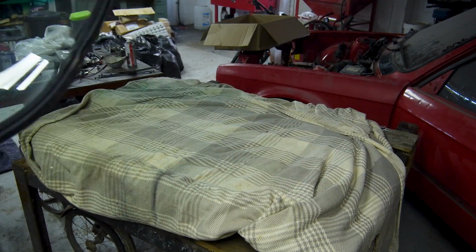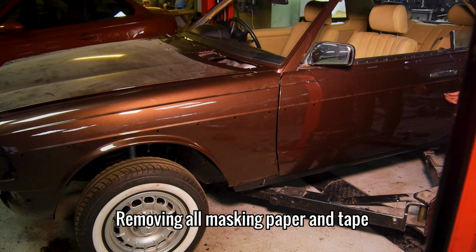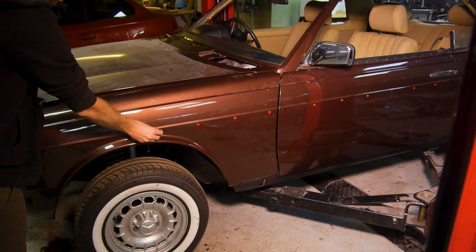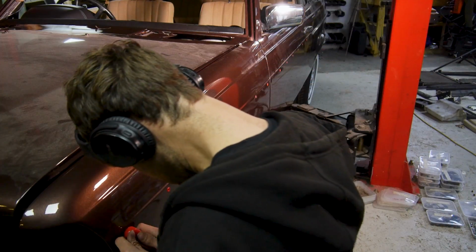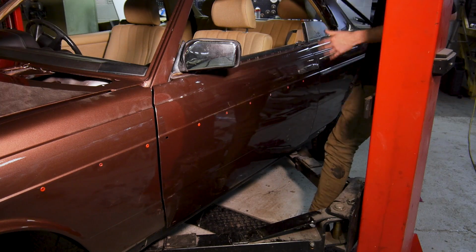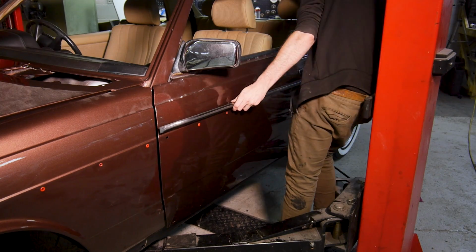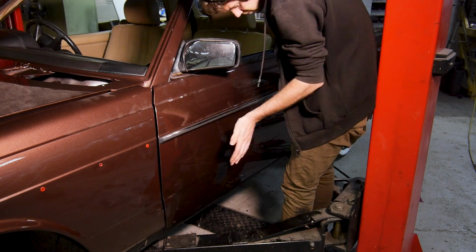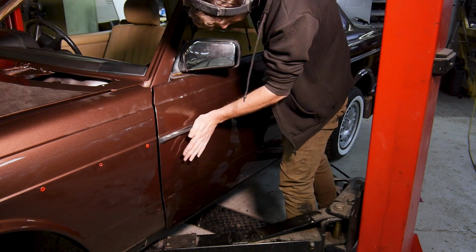With both windscreens ready to be installed, I put them to one side and got to work on installing the side trims. It turns out the best and possibly only way to install these trims is to insert the red clips first, push them fully into the car and then align the trim up and give it a good slap to make it snap into place. The rear and middle pieces both have screws to hold one side in. I didn't show it, but all of these were added as well.